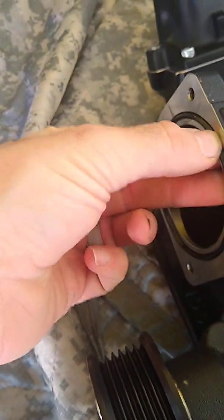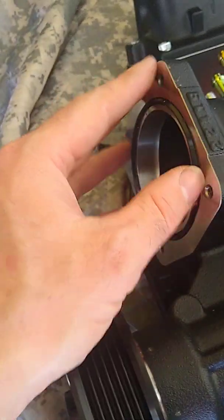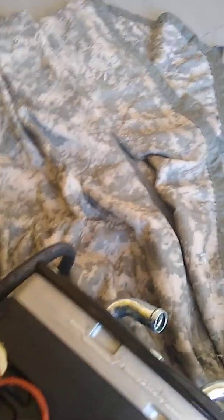This is the manifold gasket that was provided. Seems like it's perfectly fine. I've already pressure tested this multiple times. Holds pressure, or holds vacuum. Doesn't leak when I smoke it. Seems happy. I added hose clamps onto it just to make sure that there's nothing wrong with it, and that if there was a possible leak from the hose, that wasn't the issue.